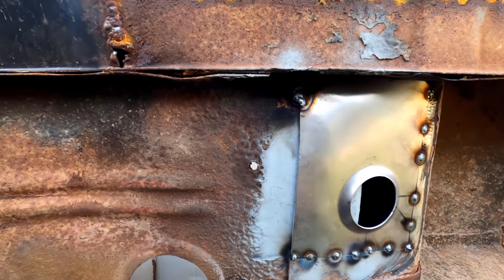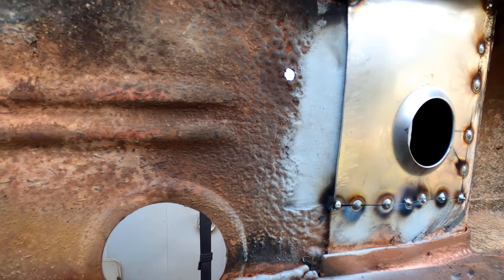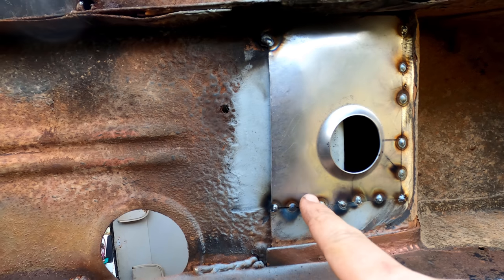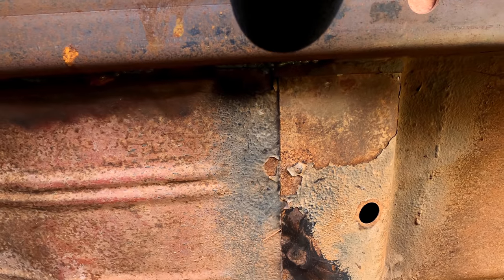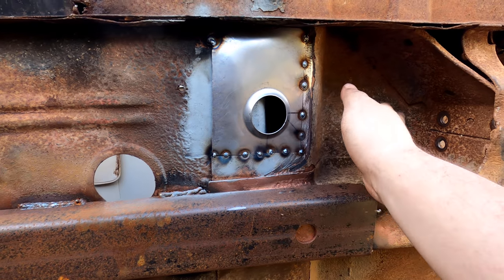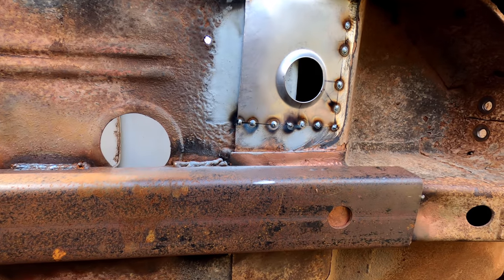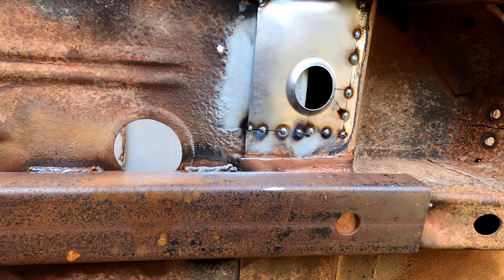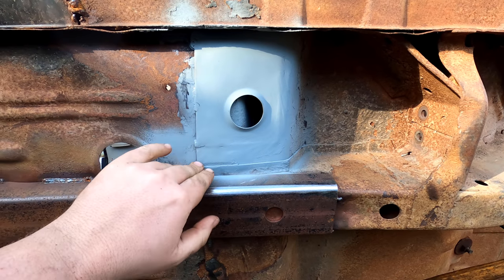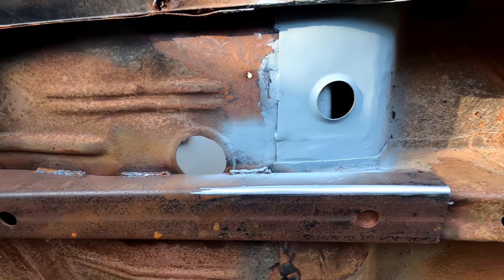As you can see, we'll just pull that form — stays pretty flat and it's pretty close to what was in there from factory. The only difference is the factory one had a little flat across here, but that's not going to matter. We'll now go and tack that in. Tacked in — a bit ugly up there but we'll sand that out; it's just because that filler's still on there with a sound deadener that's really hard to get off. It tucks in nice — tapped it around, nice and flush here and here, and it follows that same body line. On Valiants this is where they actually change the wheelbase — the bottom panel comes down, the top panel goes around, and they just pushed them apart and spot-welded them at different lengths for wagons, utes, sedans, VIPs. Patches all in, sand it up — there's a slight misalignment but it won't matter. Nice in that radius.